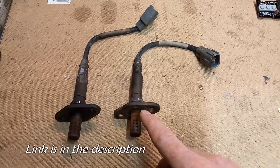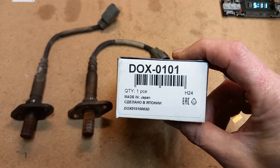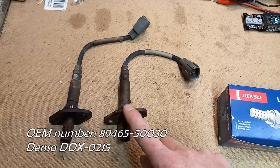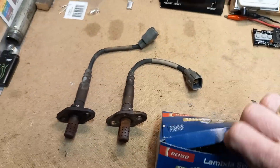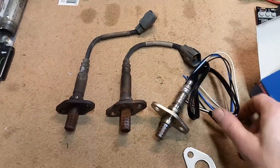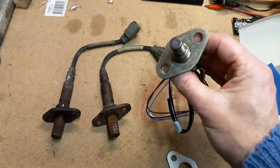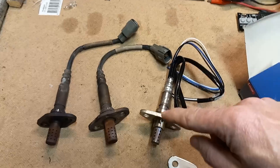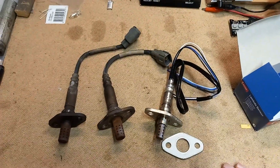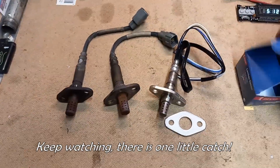I found a supplier in Poland that has the direct replacement in stock. The part number is DOX-0101, and I believe the original part number from Denso for this one is DOX-0215. As you can see, it has the same flange, and of course it comes with a gasket and a cord. The only thing I need to do is put that connector on there and then I have a direct replacement. I checked and the flange is exactly the same. You cannot unthread these O2 sensors from the flange, so you need one with the flange if you're located in Europe. That's the information I wanted to share — I can imagine other LS400 owners run into the same problem, and now I found a direct replacement from an OEM supplier.